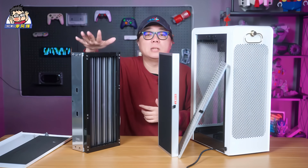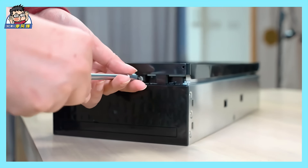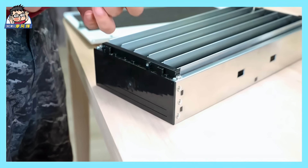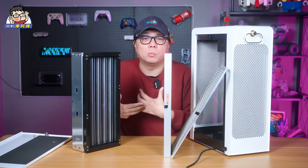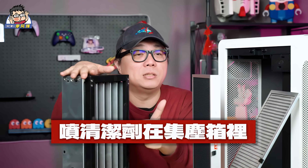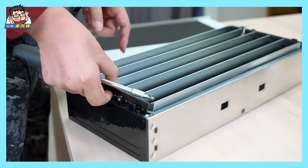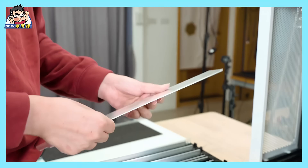Let them air dry slightly. The key point is the dust collection box. A small screwdriver included is needed, though I think it's more convenient to prepare a larger, more handy screwdriver. This assembly is not very difficult. The dust collection box includes a structure that can be disassembled with a screwdriver. I also think this is part of today's model's design ingenuity — the Boswell CL3-0140V is designed almost entirely and easily disassemblable. Unlike models with zero consumables that have integrated boxes which were difficult to clean and prone to malfunction, it can be cleaned more thoroughly and quickly. Note that before disassembly, do not wash it directly with water or spray cleaning agents inside the entire dust collection box. First, unscrew the top and bottom screws of the machine, then remove the ionization net, then unscrew the four screws on the connector, after which you can remove the two connector pieces. Then you can proceed to remove all the dust collection plates inside. These dust collection plates can be placed in a sink and cleaned with water or a neutral detergent.